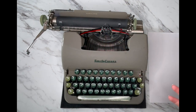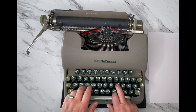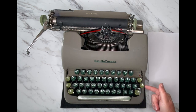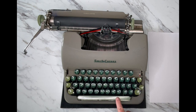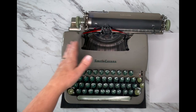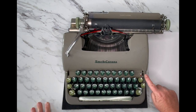When you get to the end of a line and the bell goes off, once you hit the margin the typewriter will stop and you won't be able to type or move forward. Then you hit this little tab right here that says MR and press it — that releases the margin so you can keep going if you're in the middle of a word or thought. It resets once you go to the next line.